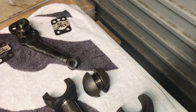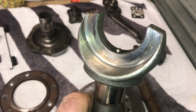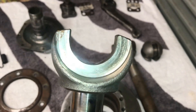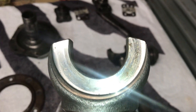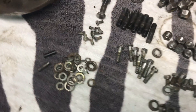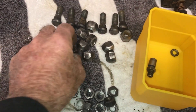All looks okay. The ball and claw — you can see there's a little bit of pitting there, case hardening. It's got some wear on it but they fit okay. There's not a real lot of movement in them anyway and there are no replacements, so I'm gonna give it a go. I'm doing all the nuts and bolts — I've seen Jason Hill wire-wheeling everything, so that's what I've done.